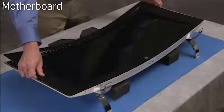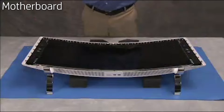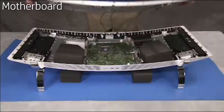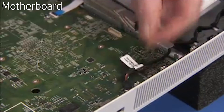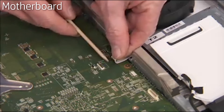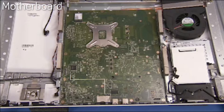To remove the motherboard, first remove the front bezel, the LCD support bracket, and the LCD panel assembly. Untape the power and OSD button board connector from the motherboard. Detach all connectors from the bottom side of the motherboard, including the wireless antennas from the wireless LAN board. Free the hard drive flat ribbon cable from the adhesive on the motherboard if a 2.5-inch hard drive is present in the unit. Detach the nine Phillips number 2 screws that secure the motherboard to the rear cover.